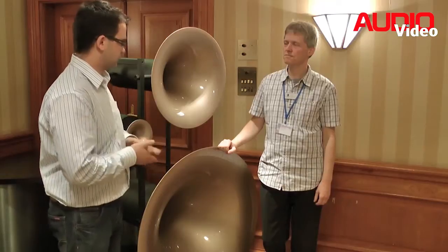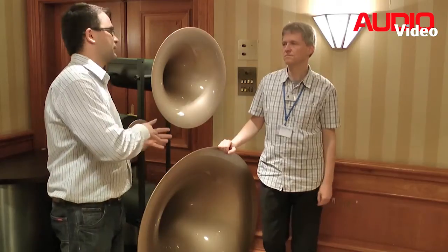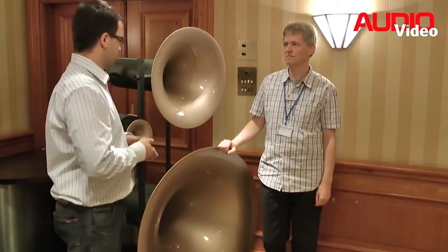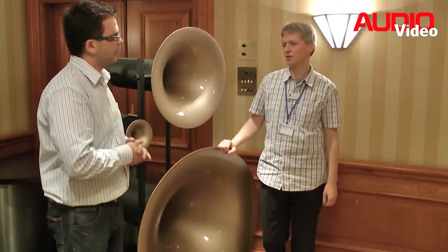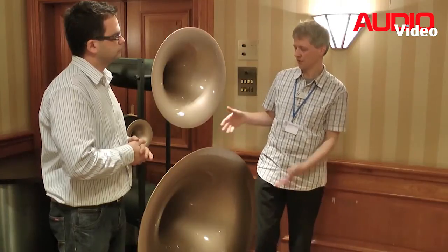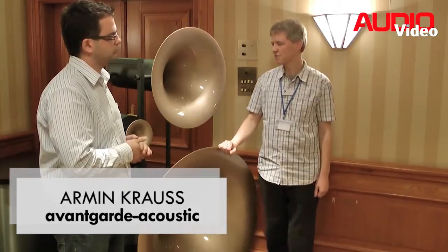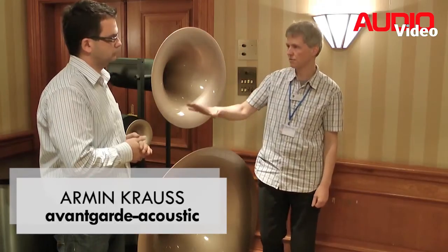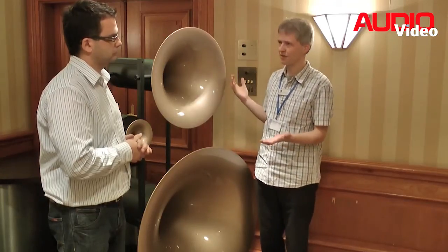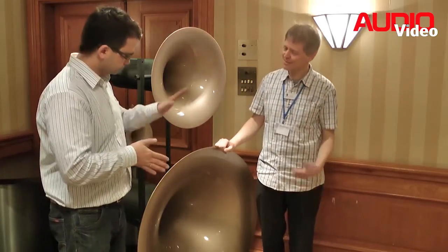Okay, how do they compare to your lesser, less expensive speakers from Avantgarde? What's the difference in terms of sonic quality? Well, we can't show it on the video recording, of course, but what's the difference according to you? Well, the most obvious reason that they sound different is that if you count the horns, you find 3 here and 2 with the others. And this means that we have much more specialized drivers for the job in these 3 horns. And this means we have more efficiency. Obviously, 109, while the smaller speakers go only up to 107, which is also not bad, but still.